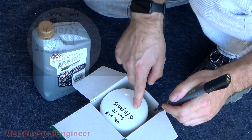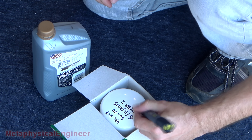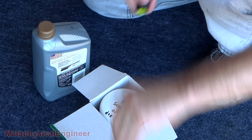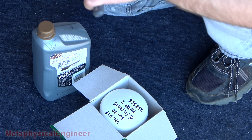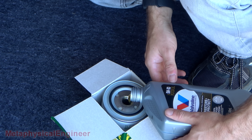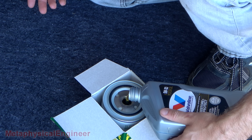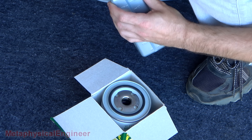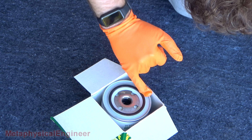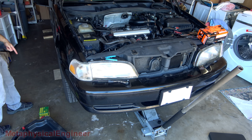Almost exactly two months later — the previous filter was put on on April 10th. It's been 2,001 miles since I put the oil in, bringing us to 258,566. Got about 10 ounces left in this bottle; filter should take most of that. Any leftover is going to go in the sump because obviously you're going to lose some when I take the old filter down. Took the whole bottle and there's still some room, but this will compensate for the majority of the oil lost with the filter change. Yes, I'm lubricating the gasket before anyone calls me out on that.